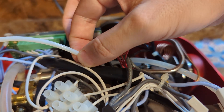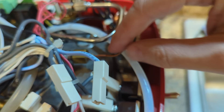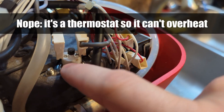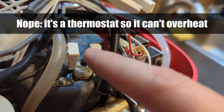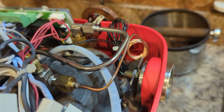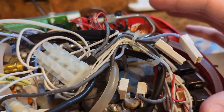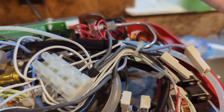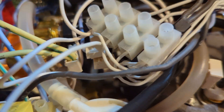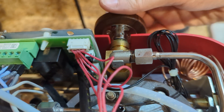The solenoid has two outlets. One outlet goes through this small hard tube - that's the pressurized water going into the group head. There's also a small diameter copper line for the pressure reading, and what looks like a thermocouple reading the temperature of the heater block assembly. The thermoblock is kind of neat - it has hard foam insulation. These are known for really good insulation; they stay hot for a long time. That's good or bad depending on preference, because once hot it takes a while to cool off. If you're switching to steam and back to a shot, you often have to flush hot water out. The other line from the solenoid three-way valve goes to a stainless line into the steam valve.